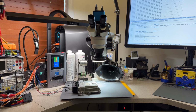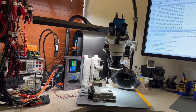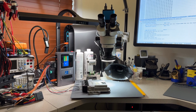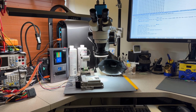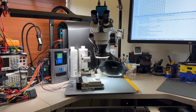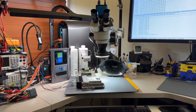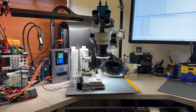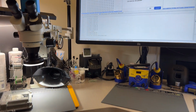We're providing a service, but I don't know how that computer is. Same thing when you're doing programming in a car, right? If something fails, I'm trying my best. I've got the best equipment, clean power supplies, good battery voltage. This is not like being in a car and trying to do programming with incorrect voltage, and that's very important. That's why I always recommend to anyone in the automotive industry to make sure that you're using a clean battery maintainer.